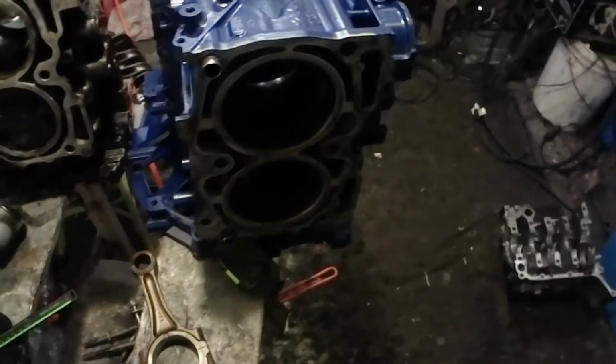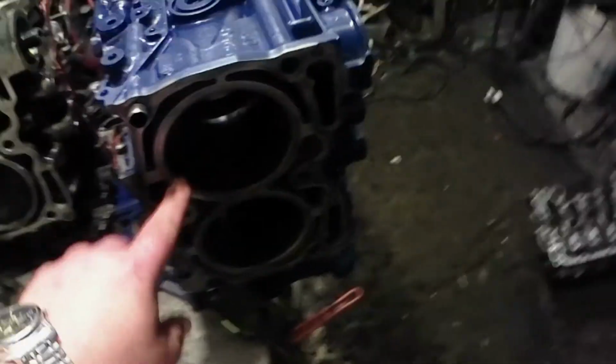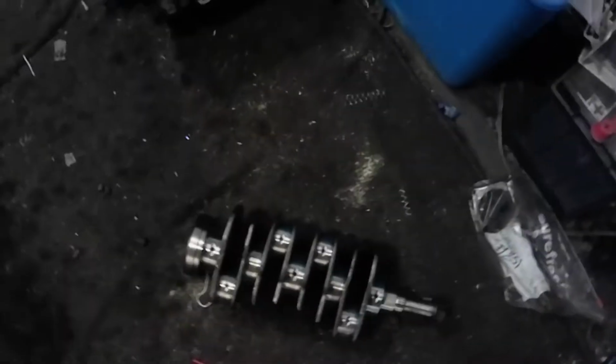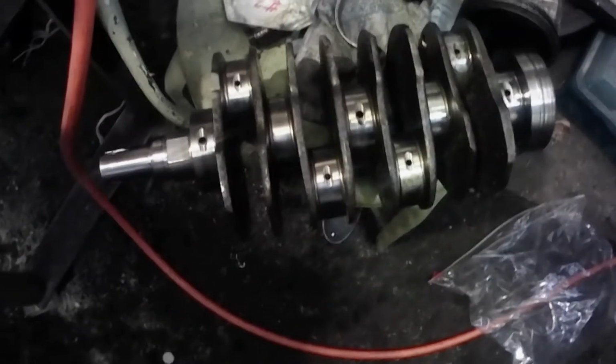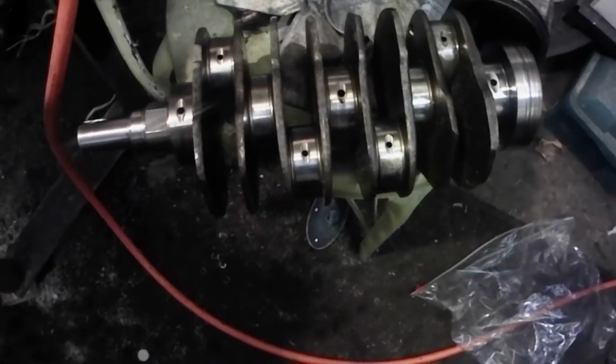But yeah, here is, you know, what you're getting when you buy a WRX STI engine. Pretty much the same, except for the cylinder supports, cast pistons, same as all the rest. The cranks between the EJ-250, here's an EJ-253 crank, and, oh, the other one, the one for the 257s is out in the shed, I'm not getting it, but here's an EJ-20 crank. I don't think there's anything special about these.